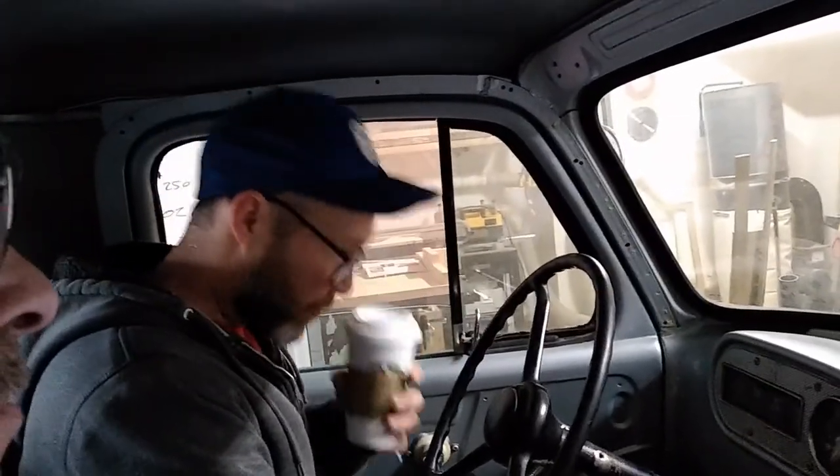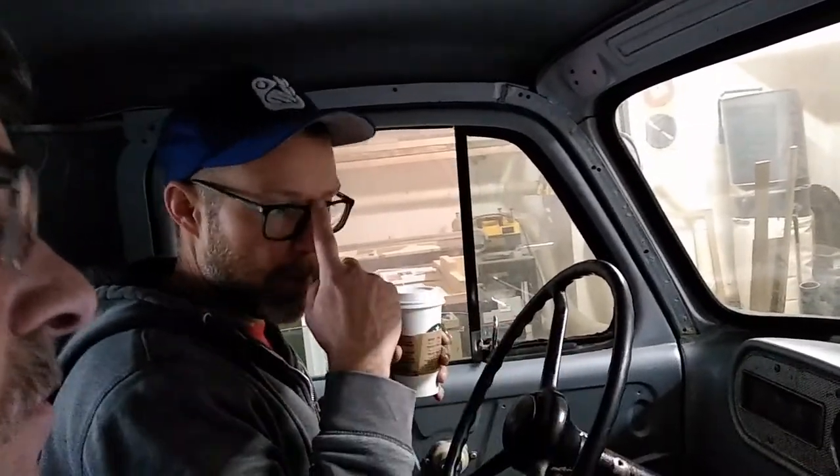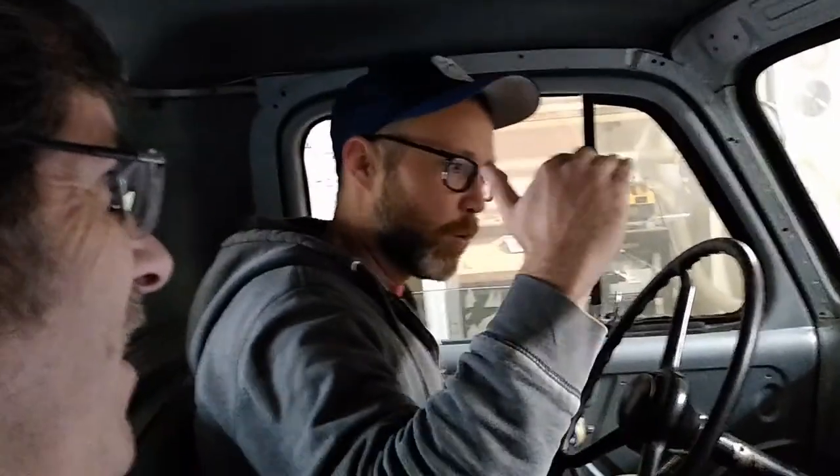These are all batteries that are like seven years old, so I'm thinking there's at least one or two cells where, when we demand a lot of current, the voltage sag brings the voltage down to the absolute minimum. It actually comes right back up again, but it just dips below that 2.6 volts. So we're going to temporarily eliminate those cells out of the system as a test.